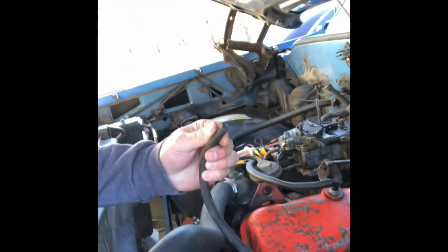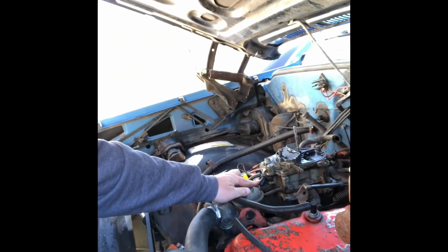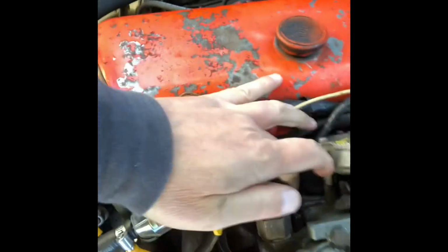I found that this actually goes to this little spot on the carburetor that I have plugged off, but the hose that I got is not right. So I'm going to either fab it up, maybe do a reducer or something, or I'll just find another port on the carburetor to slip it onto. That seems more realistic because there's a couple, but I have to put that on after I tune it, which will be this little one right there. So I'm going to whoop it around and whatever else.